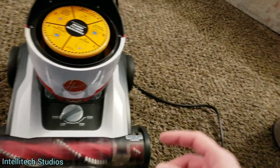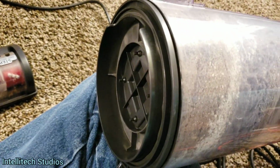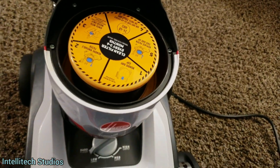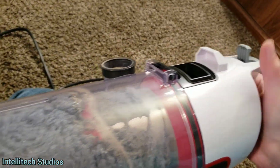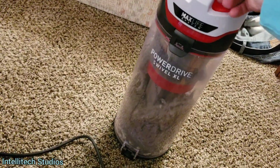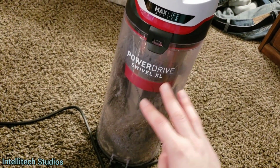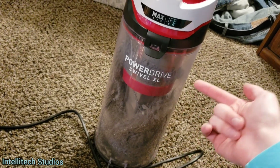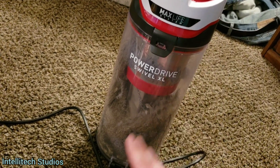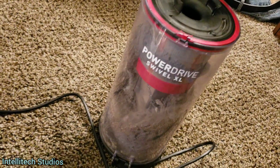One of the things that I've complained about with a lot of these machines is whenever the cyclone entrance will run through the bottom of the bin, that's very bad because that means when you empty it and there is dust left over, that'll get sucked into whatever filter this is, or potentially even the motor if the filter's in the cyclone. That's something I've complained about a lot with newer Dysons. This machine does not have that problem. In addition, unlike a newer Dyson, this is a basic dual cyclonic setup, much akin to the earlier UK Dysons and the early Phantoms, where it's just an outer cyclone and an inner cyclone. There is very little multi-cyclonic separation, but that's not necessarily a bad thing, because this has been doing a pretty good job of keeping the filter clean.